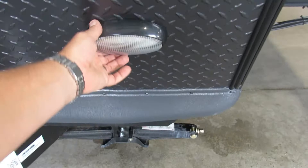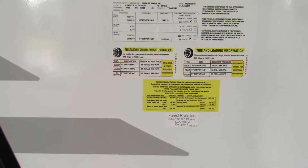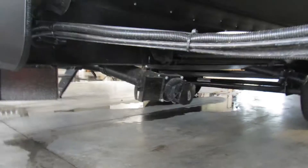You have a docking light, a little light out here, and an outside shower. This panel is where all your information is — bin locations, tire pressure, and vehicle weight. This is your bulb seal and wiper seal. We have wiper seal lube in the store — I recommend getting it and keeping that seal lubed up. Lift it up, spray some behind it, spray the outside, then run the slide in and out a couple times. And there's one of your dump stations — that looks like the gray two tank.